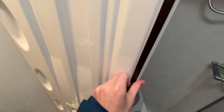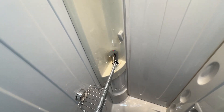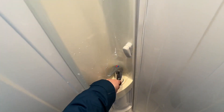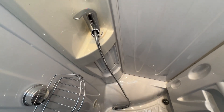The shower screen comes over to here, and by removing the turnbuckle top and bottom you can create your shower cubicle to block off the toilet. Your sink is also your shower tap — pull it out to use as a shower. When winterizing, pull the shower head all the way out and remove it from here and lay it down to stop water coiling up and freezing. When reassembling, be careful when threading the hose back into the tap as the pipe goes in and coils up.